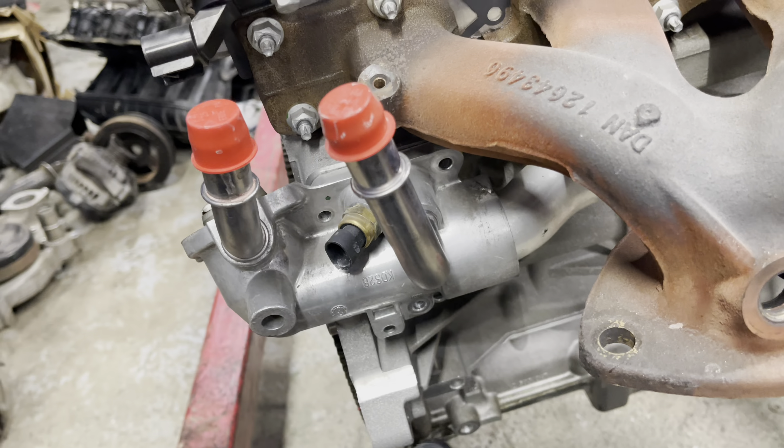Just hand-check them — I like to have that extra measure, especially on something like this. We got that O-ring in there and the O-ring here. Now we get ready to reinstall. Note that this screw faces the bottom because that would basically be the drain — to drain out what's left in the crossover tube if you ever have to service or replace it. Here we go putting the water pump back on. They're a little bit off, not totally lined up. I get my finger on there and spin until I can get them squared away.